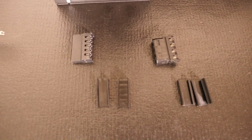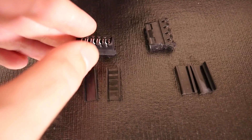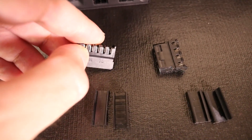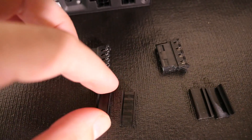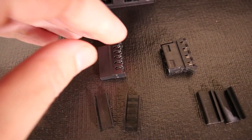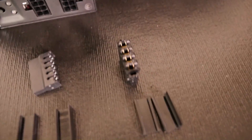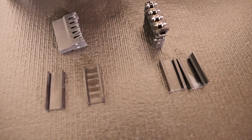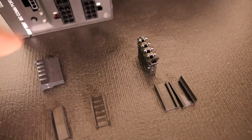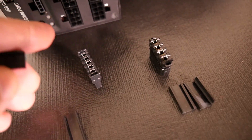Then we have a 90-degree version of both SATA and Molex connectors which have the pins built in. The wire runs through them at a 90-degree angle — you don't need to solder or even strip the wire; you just push the wire into these prongs and it cuts through the insulation and makes contact. Very easy to use, and great connectors when you have an array of hard drives because they're 90-degree and you can have lots of them lined up. That's where the different end caps come in — there are two types, a through cap and an end cap. You use the through cap when you want to run the wires through the connector to run multiple connectors, and the end cap on the last connector where you're stopping the wire.